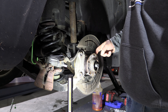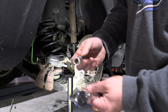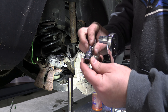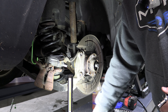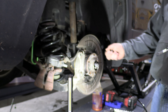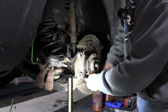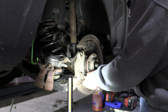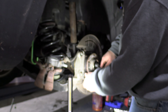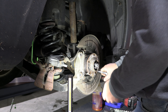Pretty much all four bearings on this truck are making noise. I've had a driveline noise in this for some time — definitely one in the front. When I had it in for inspection they stated the back ones were making noise. Since this has just about 160,000 miles and it's all original, I'm just going through the entire thing. I've already got the nut out. I've got to get the lower shock bolt out — that is a 21 millimeter bolt.